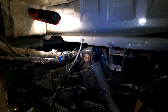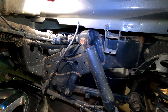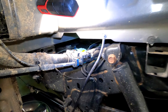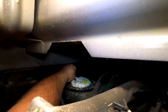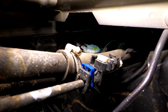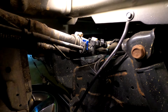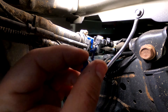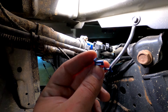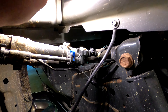Got my light set up. If you didn't watch the last video, I already pulled the wheel well liner, so we've got that out of the way — I left it off because I knew I was going to be working on it. What we need to do is get this tab here. Getting that top line off the top of the fuel pump module is very tricky. If you're not careful, these tabs are just — I mean, I barely put any pressure on it. The truck's three years old with 75,000 miles on it and it just kind of snapped a little bit. I'll have to get another one.